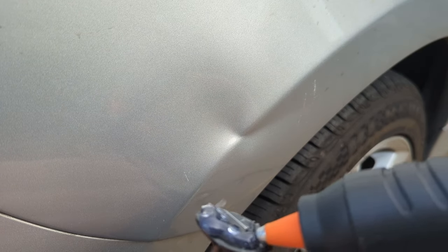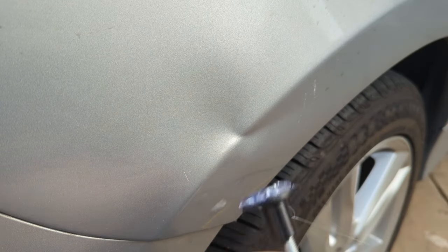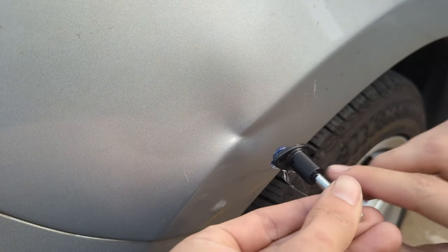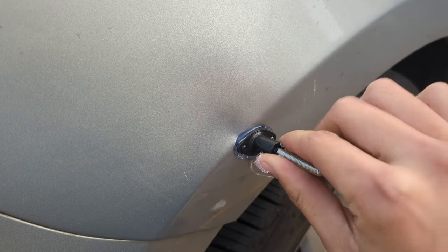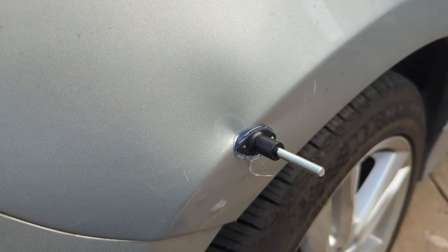Then I'm taking the hot glue and just putting a thin layer on the surface. There was a chunk of unmelted glue on the hot glue gun, but now you just take that and put it on there. Hold it up to it for a few seconds, then it should harden up. And then we can use this to pull out the dent.